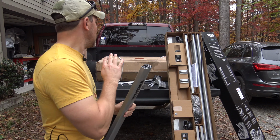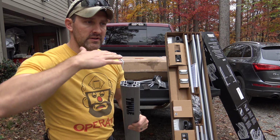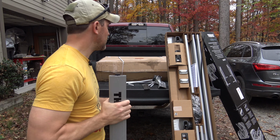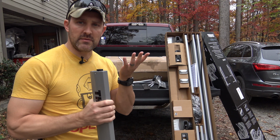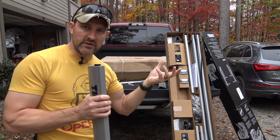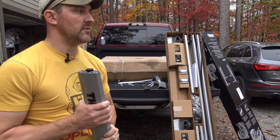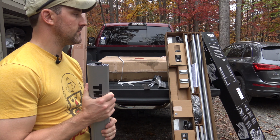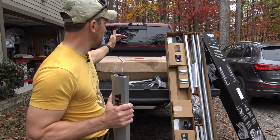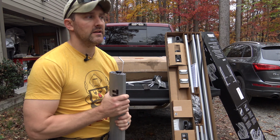Now, you can do it with the tent on, but it's gonna be kind of off camber when you loosen one. So I'm gonna look at getting like a jack, maybe putting a piece of wood up there, putting tension on it, and then loosening these, and then lowering it and raising it. That way, if I don't need the bed, and I'm not using the tent, or if I just don't need the bed, even if I am using the tent, I can keep it lower below the profile of my cab, so that trees aren't whacking it.